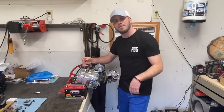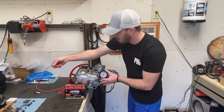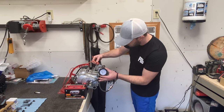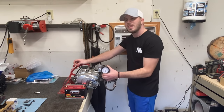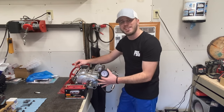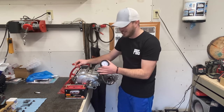Now that that's set up, I'm going to grab the compression tester. The compression tester is in place — take that negative wire, ground it, and see what we get. We're only building compression at about 70 PSI. A healthy motor is going to be in the 130 to 170 range. Anything really over 100 will probably run, but 70 is just not going to do it.